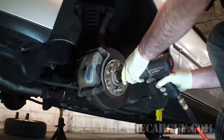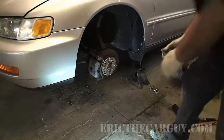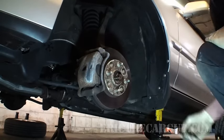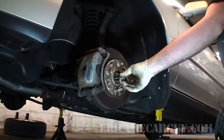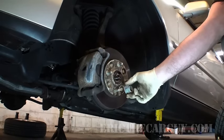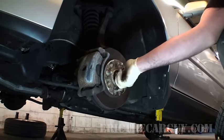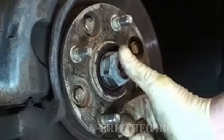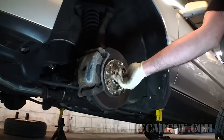But if you're in this position, you just keep spinning counterclockwise to take the nut the rest of the way off. A little bit of penetrating oil here won't hurt. Now this is the old axle, so I'm not really concerned about mushrooming it out. But if you need to hit on an axle to knock it loose from the hub and you're going to save the axle, just spin the nut back on to the point where it's flush and hit on the nut — that way you don't mushroom it out so bad that you can't get the nut back onto it.